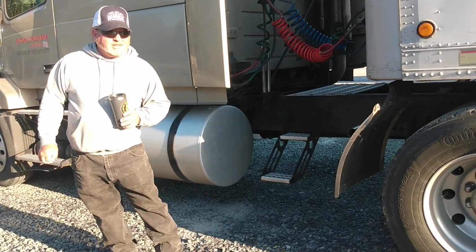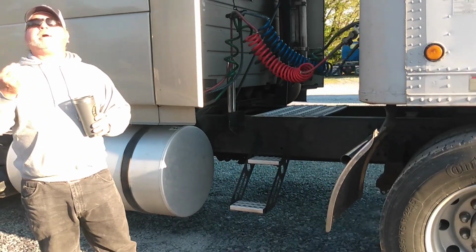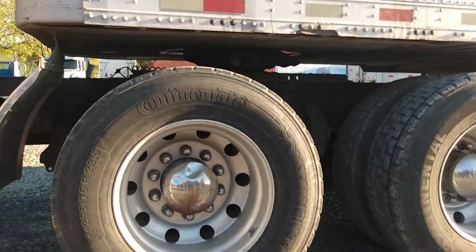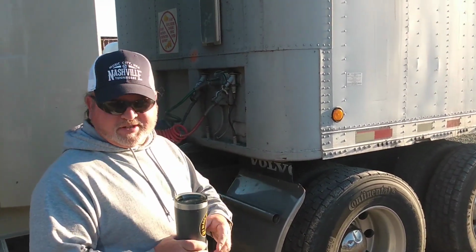Which one? Emergency. You sure? Yes, sir. It doesn't matter. As long as you got the buttons pulled out, there's no air on the system. As long as the system's not charged, it doesn't matter which one you undo first, all right? I would work my way from closest to farthest, starting with the emergency, all right?